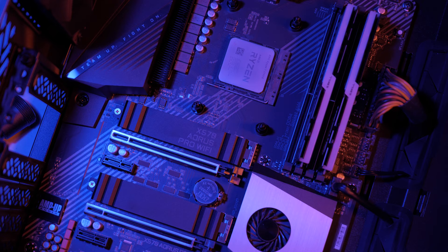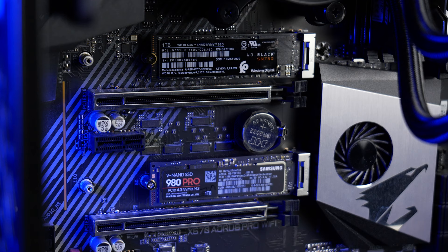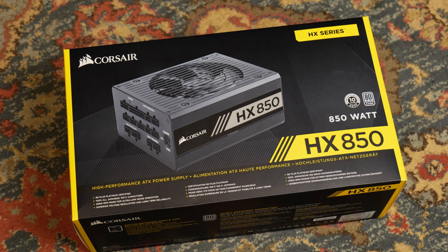I've got this machine here — my computer. It's comprised of a Ryzen 7 3700X on an Aorus X570 motherboard, two 16GB sticks of DDR4 RAM running at 3600MHz, two M.2 NVMe SSDs — one Gen 3, the other Gen 4 — one SATA SSD, seven fans including the two on the radiator, the AIO pump, and last but certainly not least, the power hog of a GPU: a 3080 Ti from Nvidia. All of this is supplied by the 850W Corsair HX850.